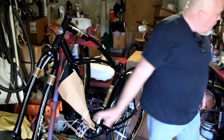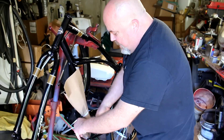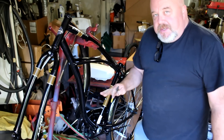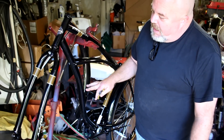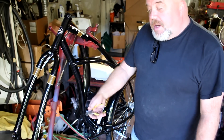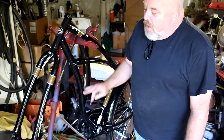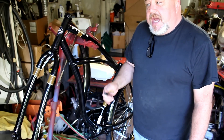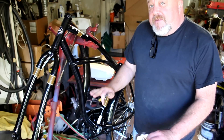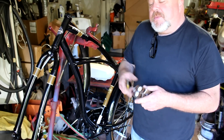I've got a brand new 29-inch bike here with some packing material on it. I'm going to be putting a 26-inch wheel set on it, ditching the 29-inch wheels. If you do go with a 29-inch frame, you're going to want to put a larger sprocket on it. Your standard sprocket is 44-tooth; you may want to bump up to a 48 or maybe a 52 sprocket. The larger wheel requires a bigger sprocket, otherwise you're going to put a lot of stress on your clutch.